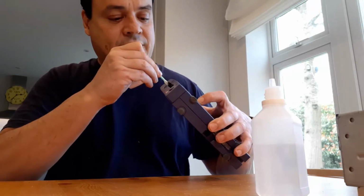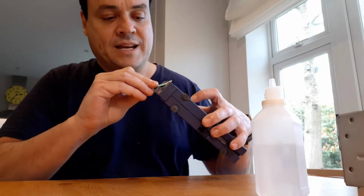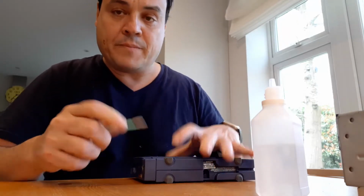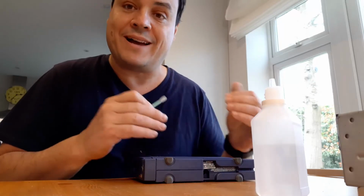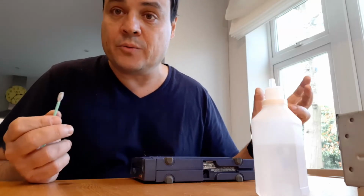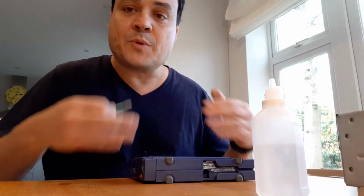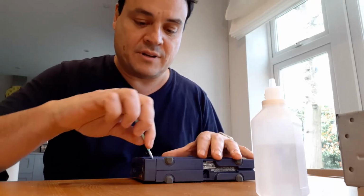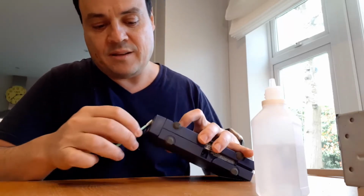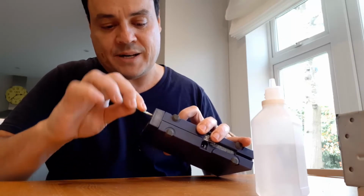And the thing is, if you take that disk that has been damaged by this problem and put it into another zip drive that is healthy, because the disk has been munched by the defective head in the other one, it actually damages the head on the good one as well. So it's kind of a contagious issue, and it gets propagated over and over. As long as you have a defective disk, that's basically how it's going to be. And that's something people took a long time to realize in the past.